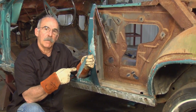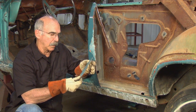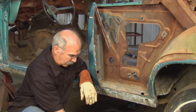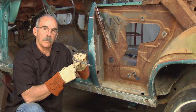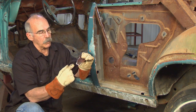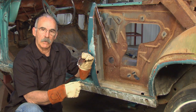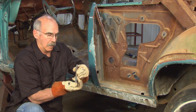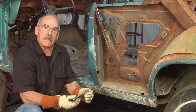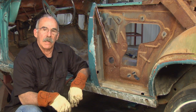The reason is when I bring the chisel up to the spot weld, it's pretty simple to bend this metal. But if the metal still has a flange in it and the spot welds are in there, when you're trying to lift the metal with the chisel, you can't hardly bend it — it just fights with the chisel.